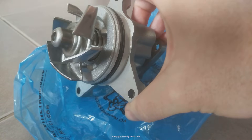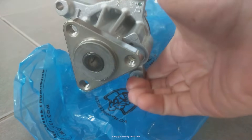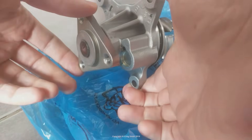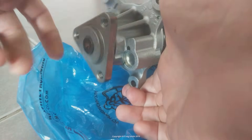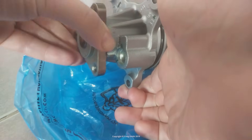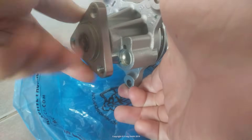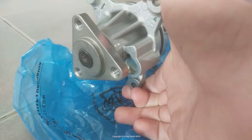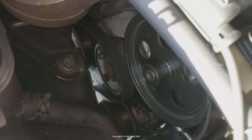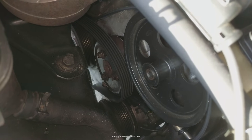This is the new one — I'll do a separate video on that job. But just here you can see how the pulley turns smoothly, and the grease that's packed into the bearings is obviously stopping it from spinning freely. So all I want to say is just don't be afraid to run the engine without the belt connected up in order to do this sort of elimination test. Just so long as you do it only briefly and you don't let it overheat, you should be fine.